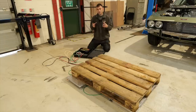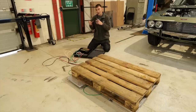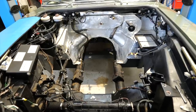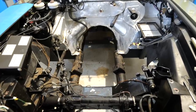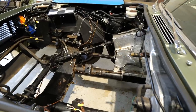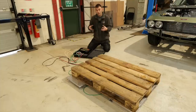We have to know the original weight of the vehicle, and with all the components removed we can figure out how much weight we're going to put back on with the batteries and motors. We have an idea of what we're going to put in this car and can calculate that weight based on other conversions we've done — but until we know how much weight has come off, we won't know if that's too much, or whether we can make the battery pack bigger and increase the range.